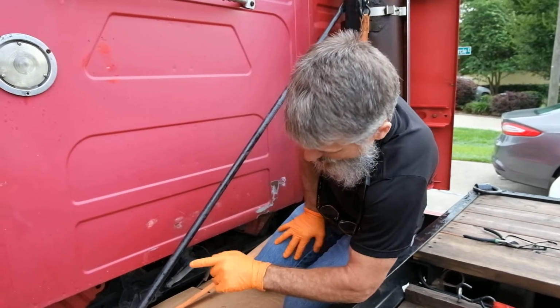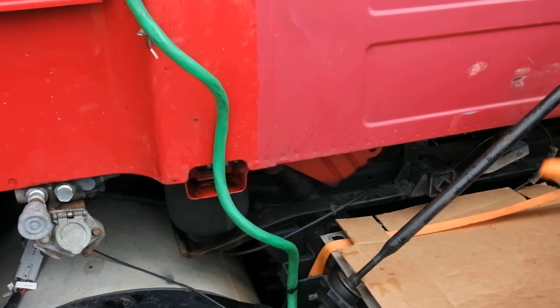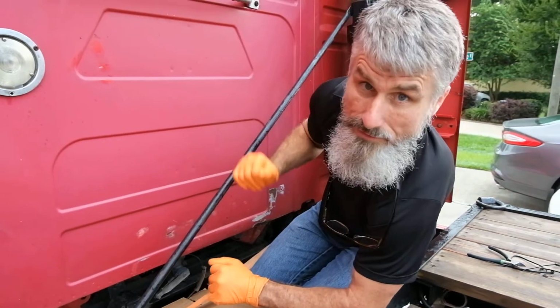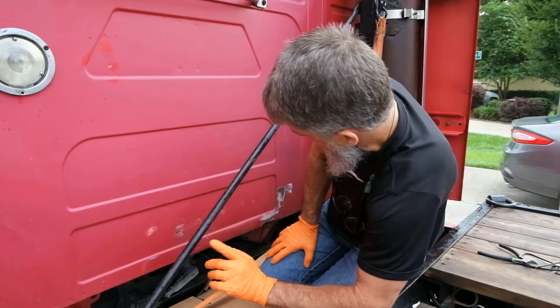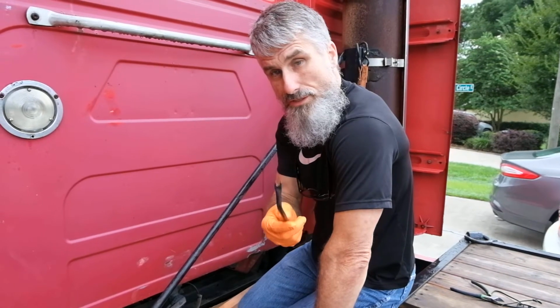We will remove the air fittings, so that we can block this line and then use air pressure to lift the truck so that we can get the valve out, the bag out. This requires a simple tool for depressing the push to connect fitting.